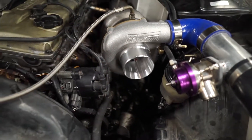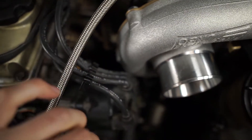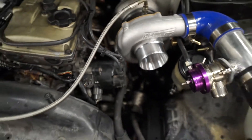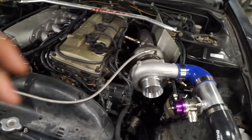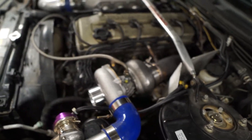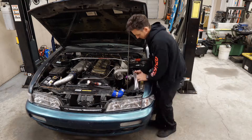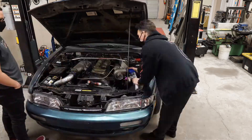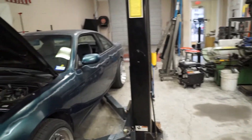We needed it to be the smaller cover because we're super close to the spark plug wires, and the next size up would have just put us into them. So we didn't want to redo the whole turbo kit just to switch turbos, especially when it was already making great power. We also kept the same .63 AR exhaust housing as the eBay turbo, so the spool characteristics should be similar. That's very important on this car because the main objective is just to mostly go sideways and shoot as many flames as possible — it's a fun cruise around drift type car with a welded differential.